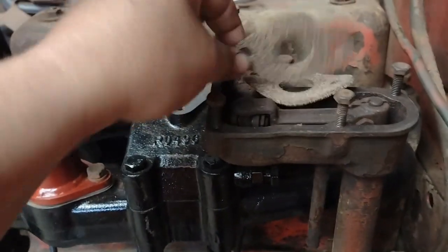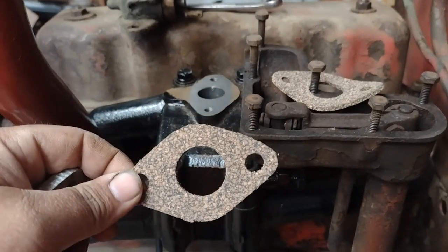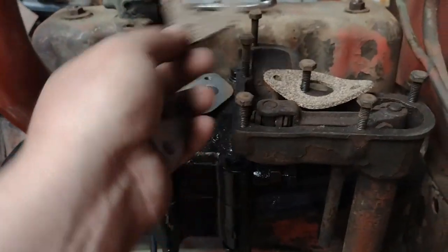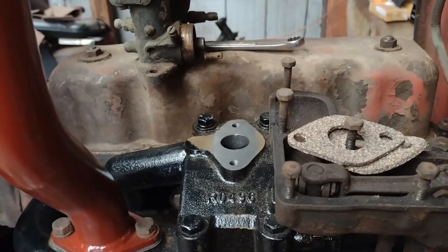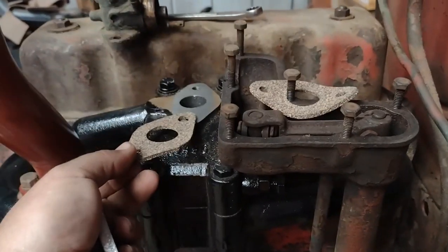Some people said to make a gasket, so I made this one — it's cork, thick cork, stacking it up like that. But I wasn't sure how well that would work. It could cause it to suck air, or if you don't have it completely sealed it'll be hard to torque five-sixteenths worth of material.